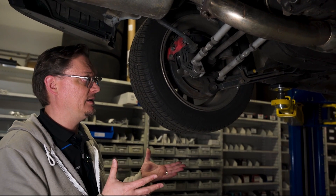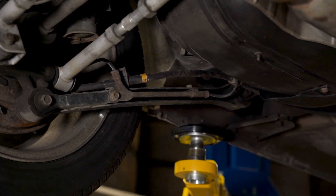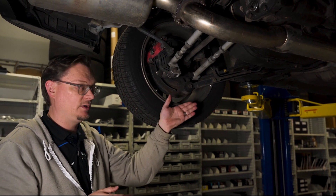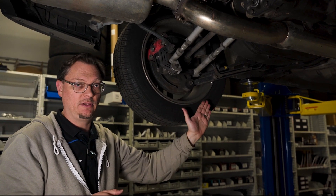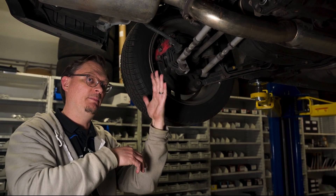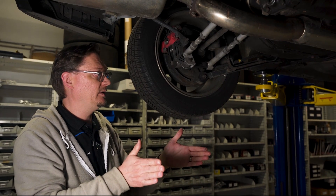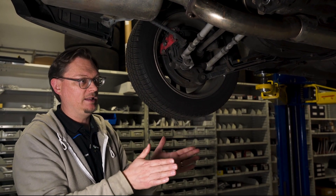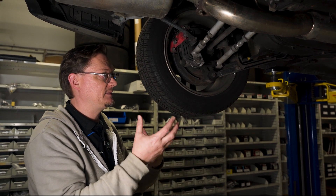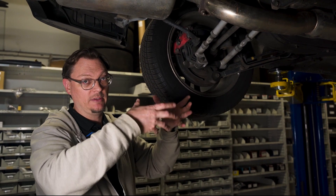Now we've got Morgan's GD WRX up in the air. If you're an old school Subaru person, this suspension looks way more familiar. We've got the two lateral links and then one trailing arm. The trailing arm is basically perpendicular to the lateral links — they're moving in perpendicular planes, which does limit the movement somewhat. As the wheel extends, the trailing arm pulls the center line of the rear wheel forward; once it reaches level it's centered, then if the wheel compresses it's pulled forward again. So the trailing arm really controls that center line movement. With two lateral links, that resists the movement more, whereas the multi-link with just one lower control arm has less resistance to that rear wheel movement.